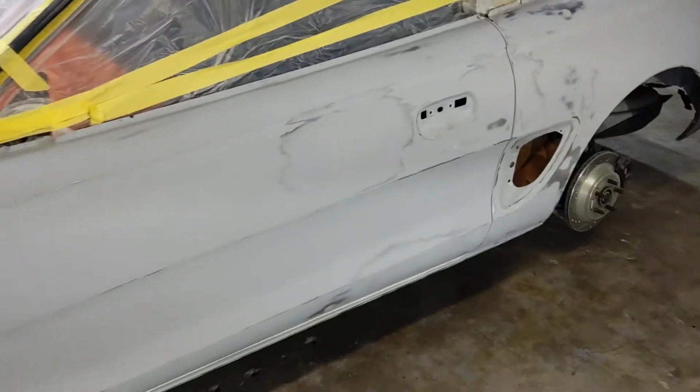Really the only issue I've had is this trunk delete part that I just straight up missed. It's my fault - I should have probably done another coat of high build primer all across that deck lid, and I should have done a skim coat of Bondo basically.